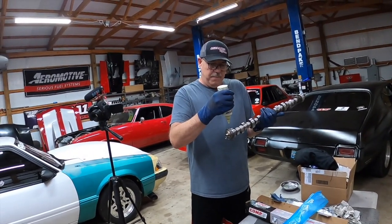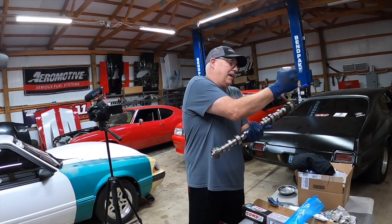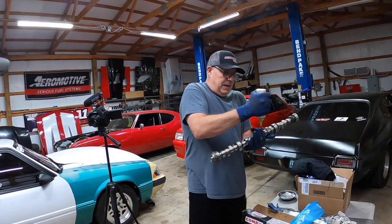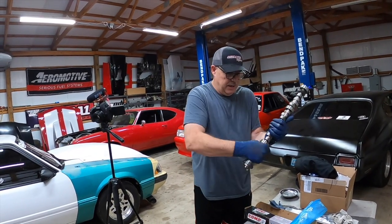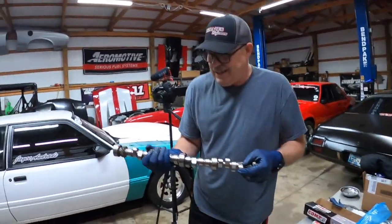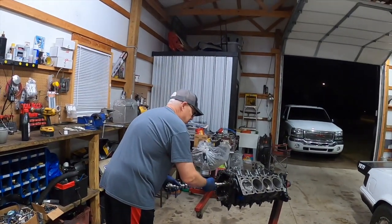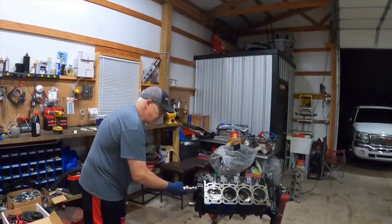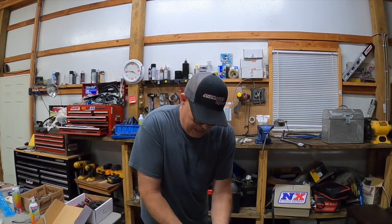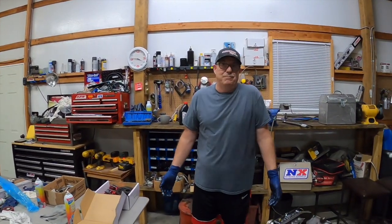But anyway, it's a custom cam. I didn't like anything that I could just buy off the shelf. It ain't like they got a turbo cam off the shelf anywhere for a small block Olds. And then he called me and he said, "Well, I know you're gonna be really upset." And I was thinking, "Oh man, he couldn't find one." He said that camshaft ended up a little bit bigger. Originally we was gonna do an 88 millimeter turbo, but he said you need a 92 millimeter now. He knows my style anyway. He said, now that thing's probably gonna be pretty rowdy. I'm like, yeah.